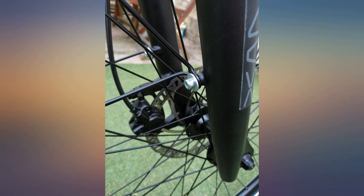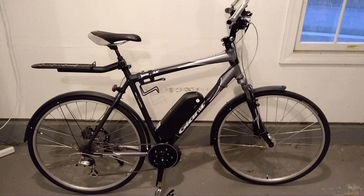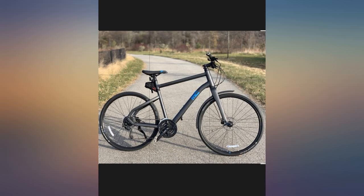I didn't think the rear upper strut would clear the disc brake caliper on the left side, but it did. I was ready and willing to cut off that strut because there's also an upper frame bracket. I did have to buy stays for my forks because they are not pre-drilled, and those are pretty high up on the fork, so it wasn't ideal. I did have to bend the struts to eliminate forces I didn't want on the mounts and make them look straighter.